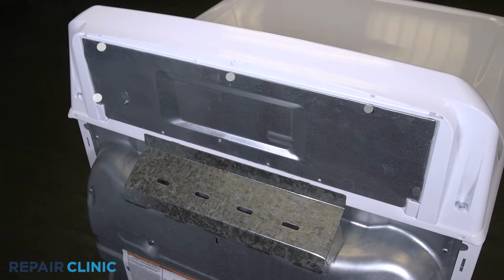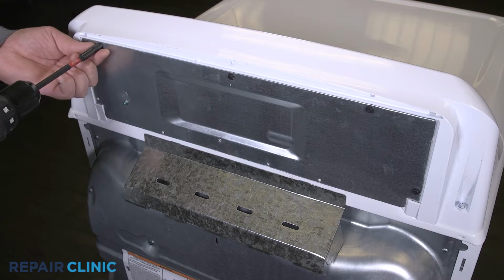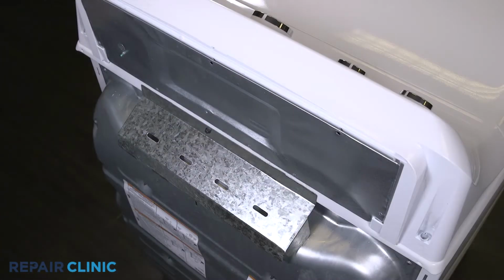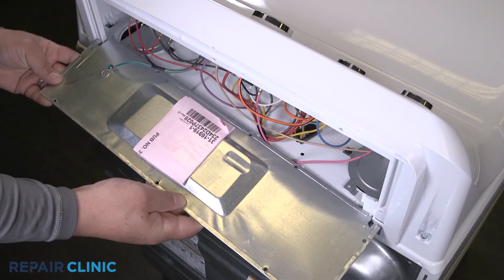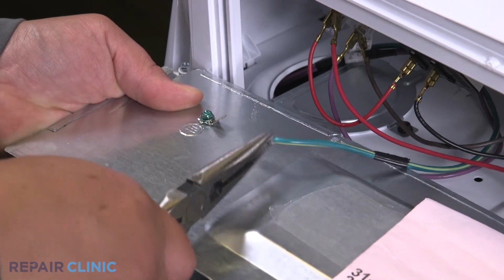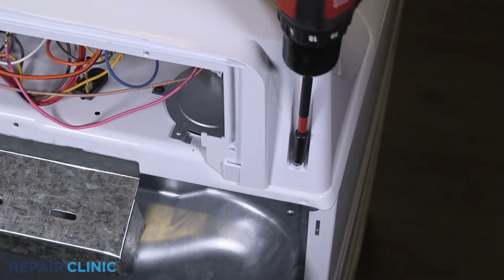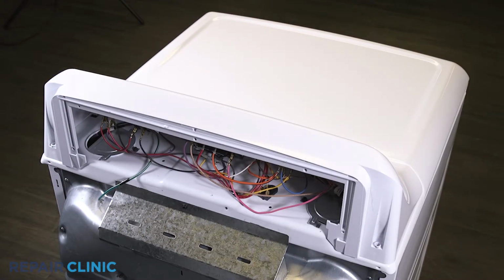Unthread the 5 screws on the panel. Any missing screws can be ordered through the links in the description below. Pull out and lift the panel from the backsplash. Detach the ground wire. Unthread the 2 screws that secure the backsplash. Pull the backsplash back and lift up to free it from the dryer.